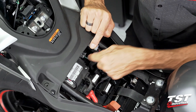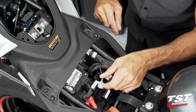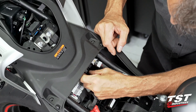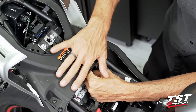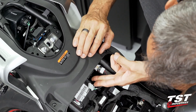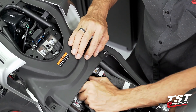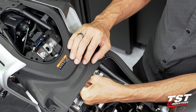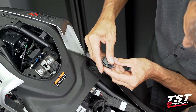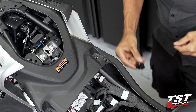we can already see the relay here. This is the OEM relay. If we unplug it by pressing down on the lock and pulling back on the white plug, now we can plug our new relay in, but first we'll need to get the old relay out of there. This is a little easier if you remove all of these components, but that's a lot of extra steps and I think we're looking for the most minimally invasive procedure here. So you can basically just push up on that relay until it clears its rubber keeper. It hangs in this orientation — this tab slides into this rubber keeper here. So we need to figure out how to get that done with our new relay.